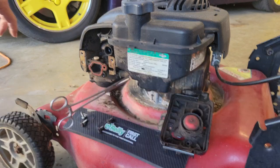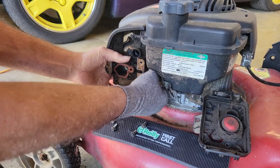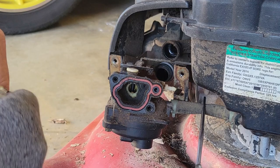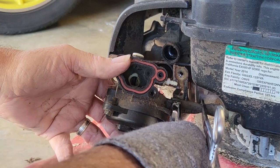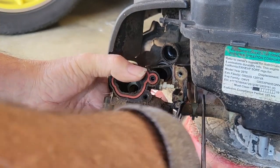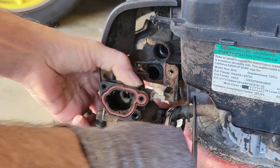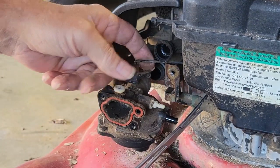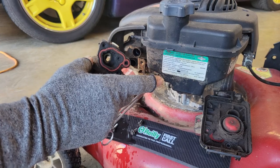Remember to take lots of pictures — this is a pretty good time to take a picture, and a pretty good time to take a picture inside here too. This will pull right off very gently — sometimes not very gently. Now you don't want to go past that because there's a piece of linkage up here, but this allows us to reach the fuel line more easily. Now that our fuel line is released we may get a little bit of fuel out, but we know we've got the line kinked so not much will escape — only a few drops. Now we've got our carburetor loose, so let's take it to the bench and rebuild her.